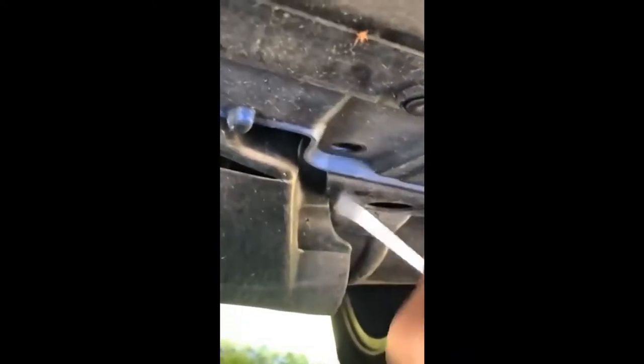You're also going to want a 5 millimeter Allen wrench or a flat blade screwdriver. You should have a bolt right here — mine's missing because I lost the skid plates over a stick in the road. You'd find one right here and one on the other side. You can use a flat blade screwdriver to get them out, or a 5 millimeter Allen wrench. Worst case you could use a pair of channel-lock pliers to get them out easily.